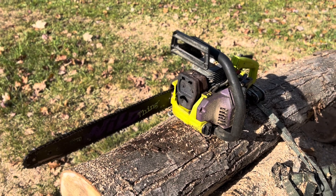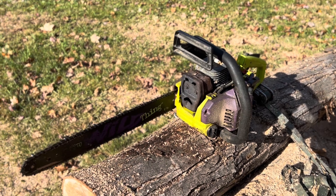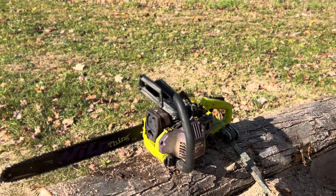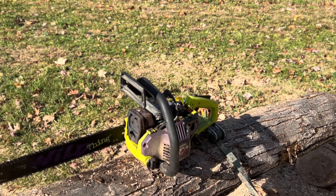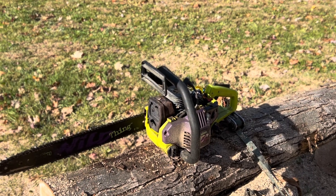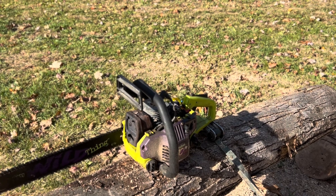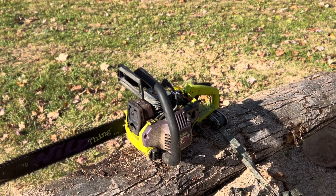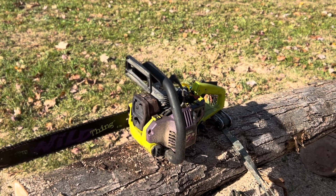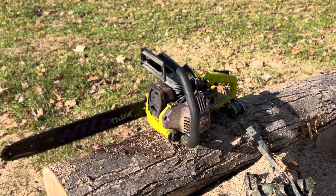That's where we are so far. That's methanol — no gas involved. The carb, I think I'm going to have to do a little more tweaking to get it to tune perfectly, but it's close. I think I'm at the limits of what I can adjust out of it. She could take just a touch more fuel on the carb mod. But in order to go to nitromethane I'm going to have to modify it a lot more anyway. That's the first stage in our process.